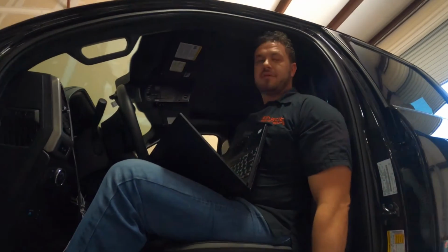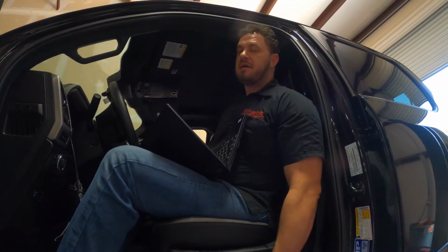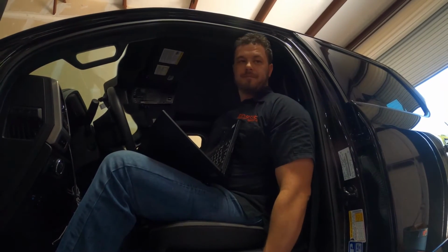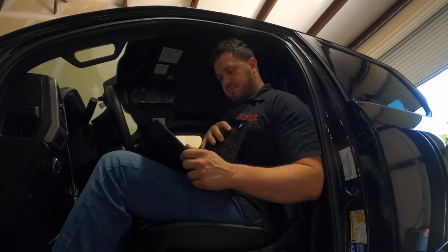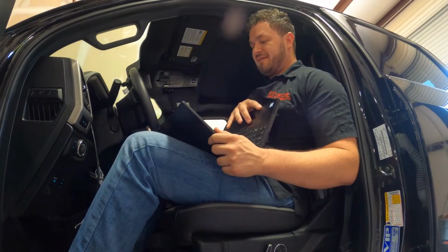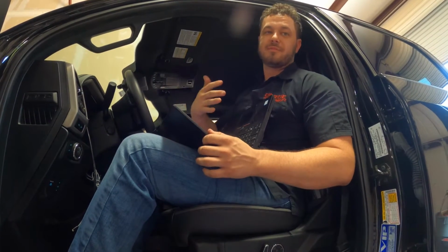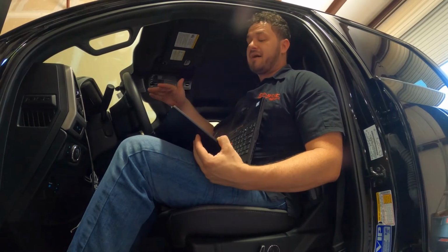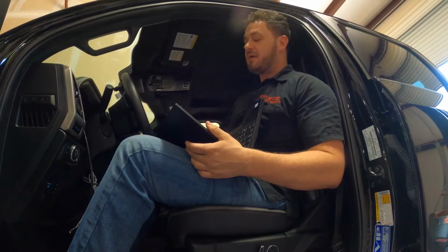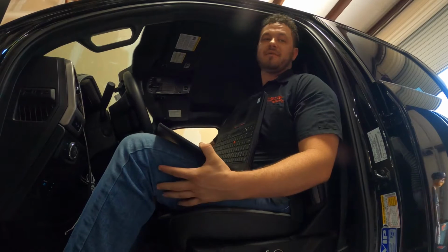Add cooling on a boosted car. Really? Okay. Bigger intercooler. Okay. Intercooler, piping, stuff like that. Especially in this weather. Yeah, exactly. So you recommend an intercooler, bigger pipe, would make a big difference too. Okay. Yeah, I mean, the inlet air temperature just in the intake is over 115 degrees. Oh, so the intercooler's having to do a lot of work to bring it down. And you're kind of limited to that number. It's never going to go below 110 degrees. That's right. And that, exactly. The cooler you can keep a turbocharged or boosted car in general, the better it's going to be.